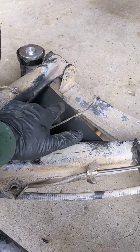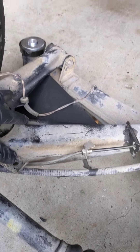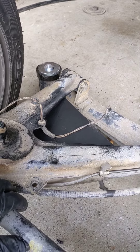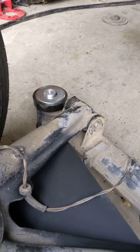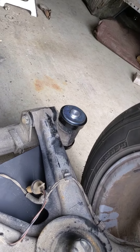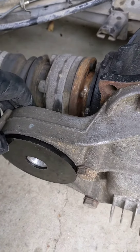These plates on the bottom here act in tension with this webbing kind of in the middle and add torsional rigidity to the trailing arm, and that's what basically connects the wheel to the subframe there. Also, we've gone with polyurethane trailing arm bushings all the way across, and polyurethane subframe bushings and a diff bushing.